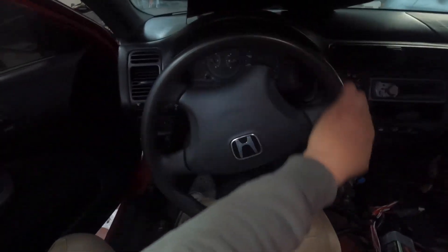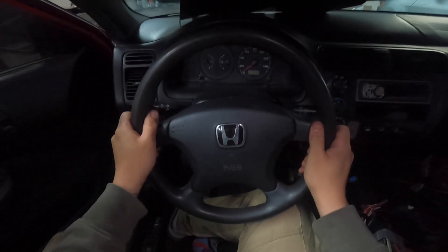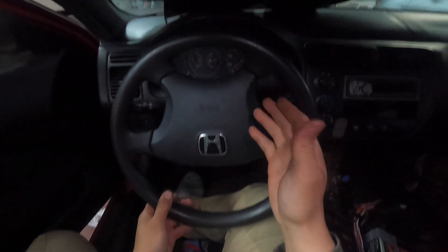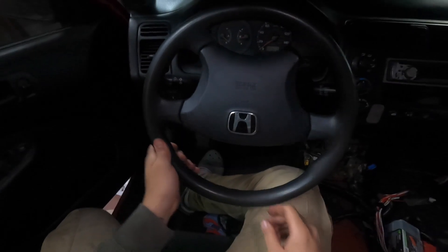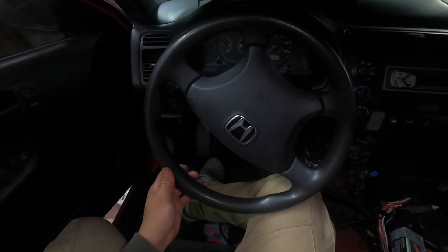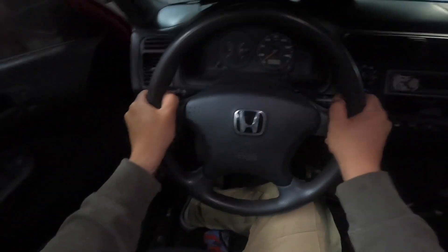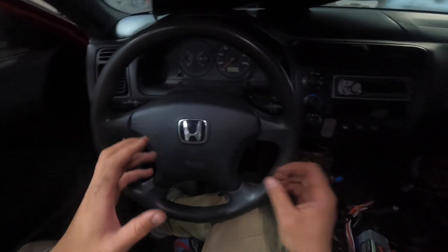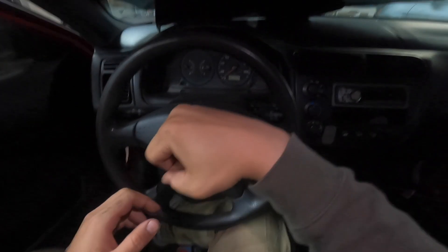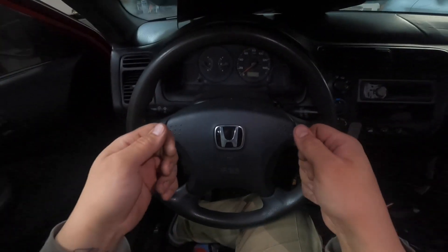So this way — one. And we should get like a quarter. This way — one. And we should get a quarter turn. Oh, one and a half. Since this one goes a full turn and then stops like halfway, we need it to stop sooner. We want it to stop like maybe around right there or something. So let's get it back to center. We'll pull that off — this little spline thing. We'll pull it off, turn the spline on the rack clockwise just a little bit, then we'll center the steering wheel up and drop it back in and check it again.